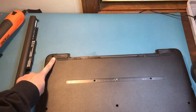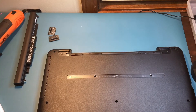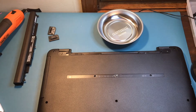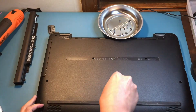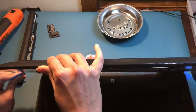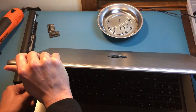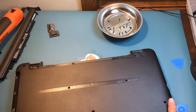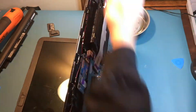Make sure to grab your double-O Phillips screwdriver and a magnetic tray to secure your screws. In this case, we have to remove 14 screws, two of which are right behind the battery compartment. I want to emphasize that because I screwed up when I tried to return the back cover — I thought there were two extra screws, so I don't want you to make the same mistake. If you want to remove your DVD drive, you can use a SIM card ejector, but you can only remove it right after you remove the screws.